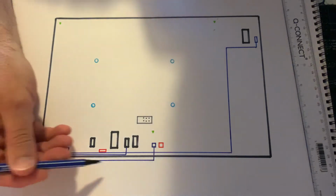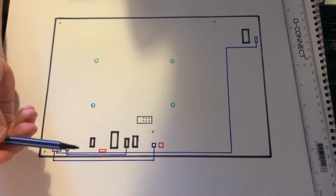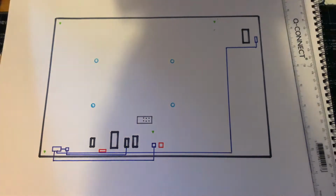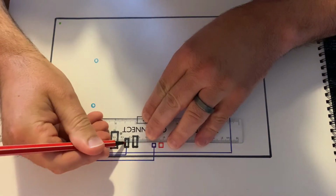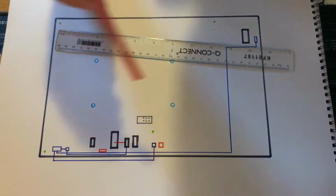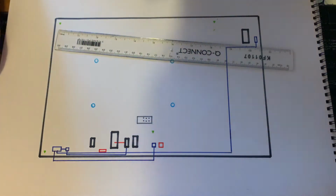That consumer unit then will, at the very least, provide power to the CBE socket that is above the worktop. Now, back to the 12 volt leisure battery charger that the consumer unit also feeds. Once it provides power to that charger, that charger then provides power to the leisure battery. Thus, we're providing power when we're on hookup, which means that we can use other items inside the van, as that battery actually feeds the control panel and other areas of the van, which we'll speak about later.